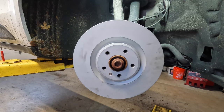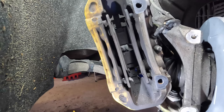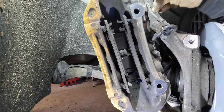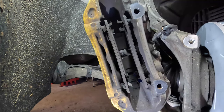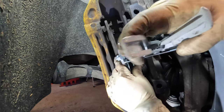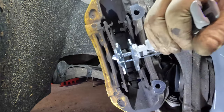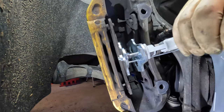Now we're going to go ahead and do some brake pad swapping and cleaning up on the caliper. This is where we need a special tool — we need to compress the pistons all the way before we remove our brake pads. I'm using a Lisle twin pad separator: you put it in the middle and pump it up to give us the room we need. Unfortunately, my tool kind of broke apart on me last time, so I'm going to have to go to plan B.